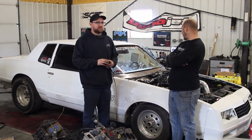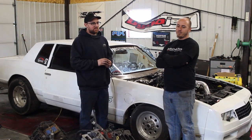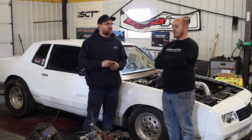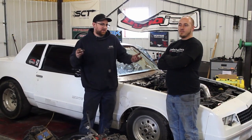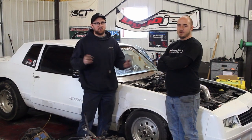It's got 241 heads, slightly lowered compression stock, right at 9.0. We're not really going for a high dyno number. My main concern is safeties. We'll keep it a little hot, see where it's at, what it can make. We know we're going to run out of fuel system, but we're going to have some fun and see what it will make safely, and then he knows where to upgrade from there.